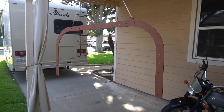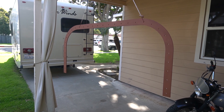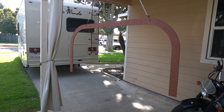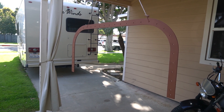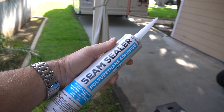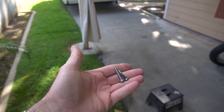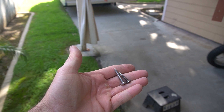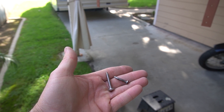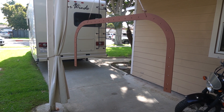It's the next day and I've gotten some primer on the new reinforcement backing plate — not that it really matters, maybe a little anti-corrosion, since this is all going to be hidden underneath the headliner. My next plan is to separate the original metal Ford cab roof open as much as possible, then squeeze a bunch of this seam sealer into it. Then I'll clamp the reinforcement plate back into place and fasten it with new screws. The new ones are going to be number 12 by one and a quarter inch. Let me go ahead and squeeze the sealant into the cavity on the cab.